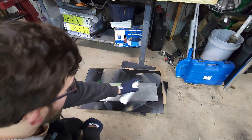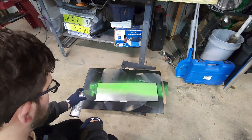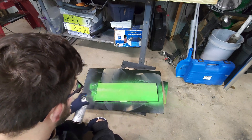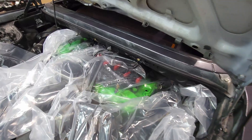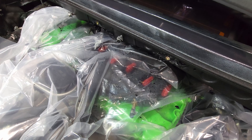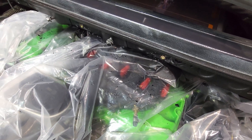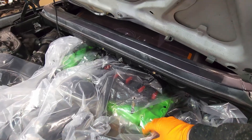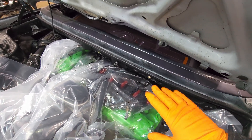I'll hit it with some green in case I do get caught with it installed. Off camera I tried to do a test fit and both of my studs were stripped out, so I wound up breaking them off and put some riv-nuts in place of them — you can see where the brass-looking pieces are. That's what I'll be using to attach it. I put the plastic here to catch any debris from drilling and I'll leave it on for the rest of this.